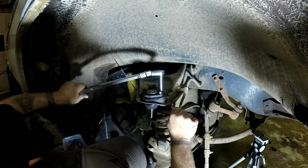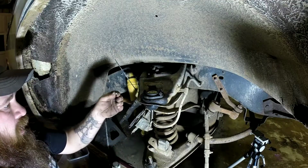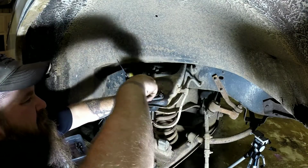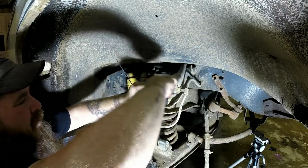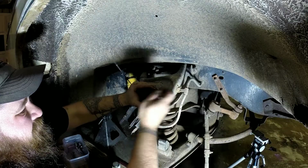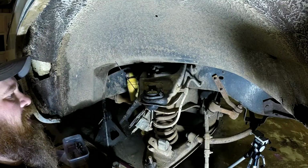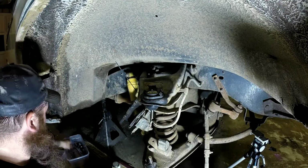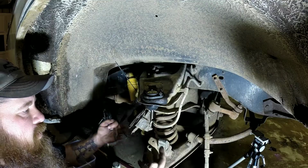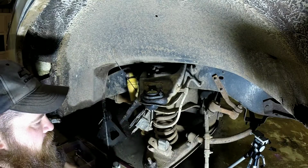And you'll want to tighten them in a crisscross pattern. Now you don't want to forget your grease zerk. Most of the time they're not threaded, so you have to take your time and make your own threads. Don't want to over tighten it and snap it off, and then you got a whole nother mess on your hands. Now if you're just doing your upper ball joint, you could have left your steering knuckle on this bottom one, a bit kind of in the way, but it's doable.